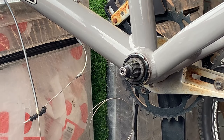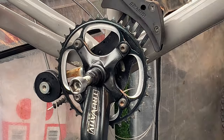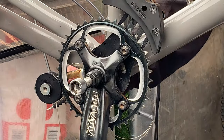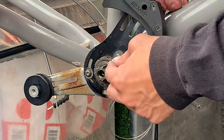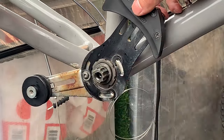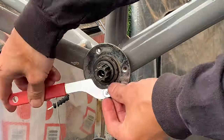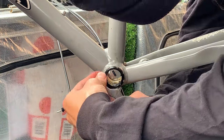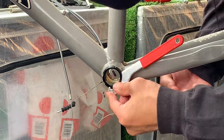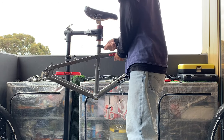Same process on the drive side - realized I needed to take the chain guard off first, then the same method worked pretty easily. The chain guard undoes with an allen key. For the ISIS lock ring, you're meant to use an 8-notch tool but I tried with what I had - the other side was too tight so I decided to order the proper tool. I left the lock ring for now and will show that in the next video.